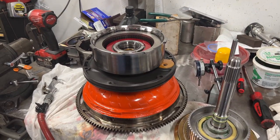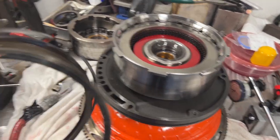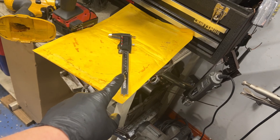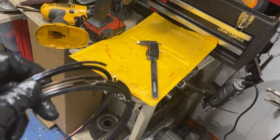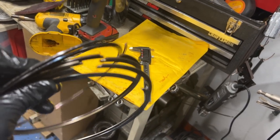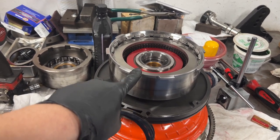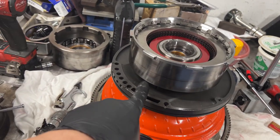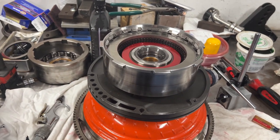When you're setting up the clearances in these drums, you use snap rings that are actually different thicknesses. I put my dial indicator on them - they make like a 0.061, 0.062, 0.088, and 0.108 - and that's how I can swap these things out and get the correct clearance according to John's instructions. With his valve body he wants between 0.075 and 0.085, so that's what I'm doing right now. It's the same process: put air to it, set the dial indicator on it, check and check, then swap the snap rings around.